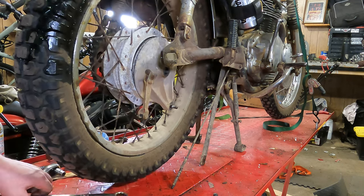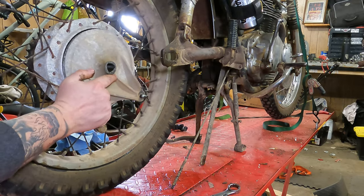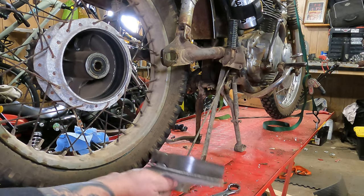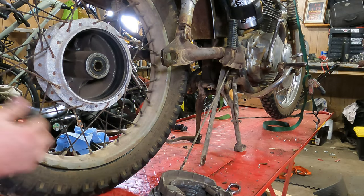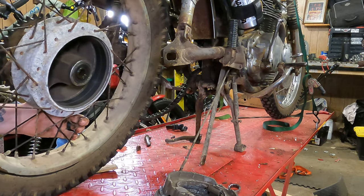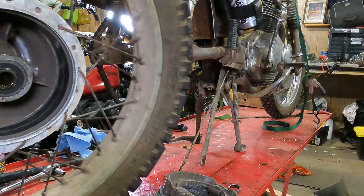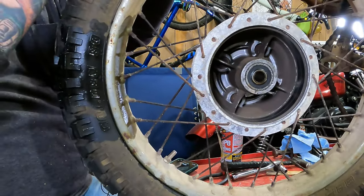Move your stuff and tools out of the way, then roll your rear wheel back. Take your brake drum out and set that to the side — you also want to keep any grease and dirt off of there because that's your braking surface. Then you can roll the wheel backwards. You might have to pitch it to the side a little bit to get the tire to clear the fender, but it should come right out of there. It's that simple.